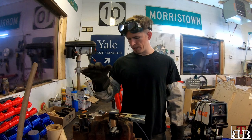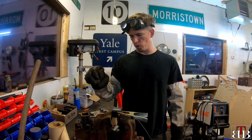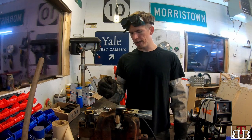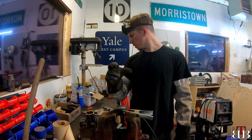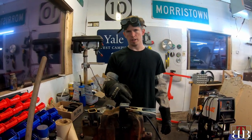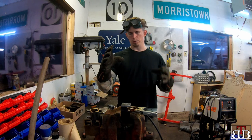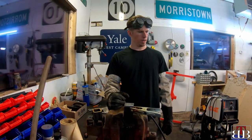So we are making some spacer cubes right now. These 2x2x2 cubes are for the rear front lower control arm stud and for the transmission mount. We're going to get some extended bolts. I think these are M12s or M14s. M14s, those are M12s. Just in a longer length, and we'll use these blocks to space out to correct our suspension geometry and give us that additional 2 inches of lift.